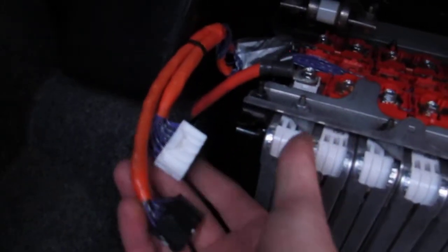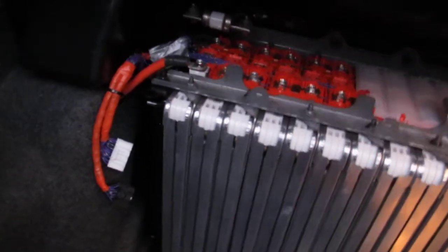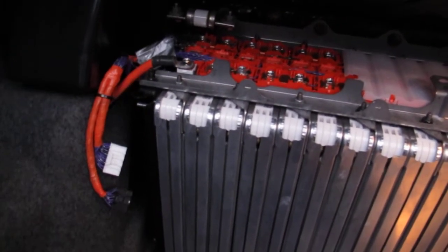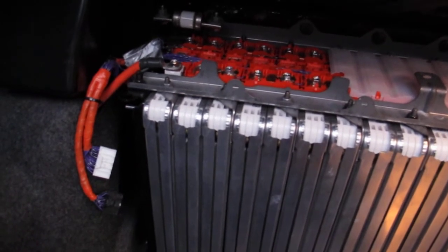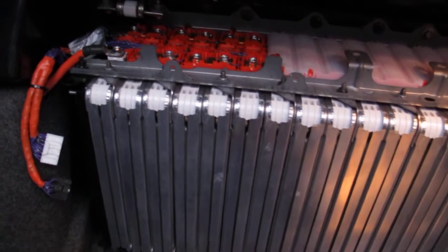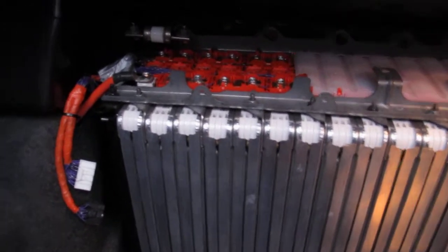There's long cables with resistance in between, so when you're charging, I think imbalances are inevitable. So you can see in the back I have these original cables and connectors for the battery management of the Nissan Leaf. Some people might know that you can reuse the Nissan Leaf battery management system, but the trouble with it is it's designed to be split into 2 parts that are isolated, and you have to split it in the same way that it was split in the production model in order to use the whole battery management system, because it's meant to be isolated. If you try and use it in a way that wasn't intended, the circuit board will be damaged. So I think it's better to start from scratch and design something purpose built for these cells.